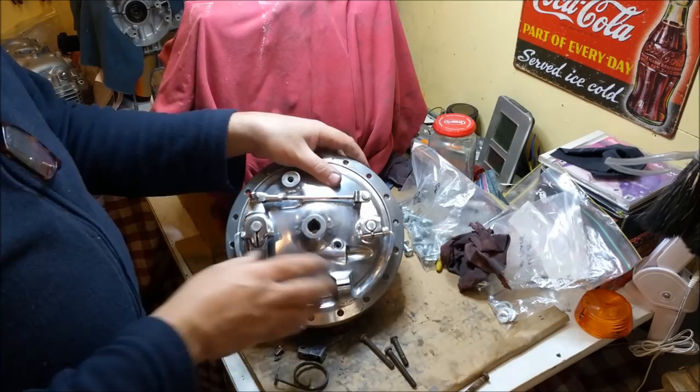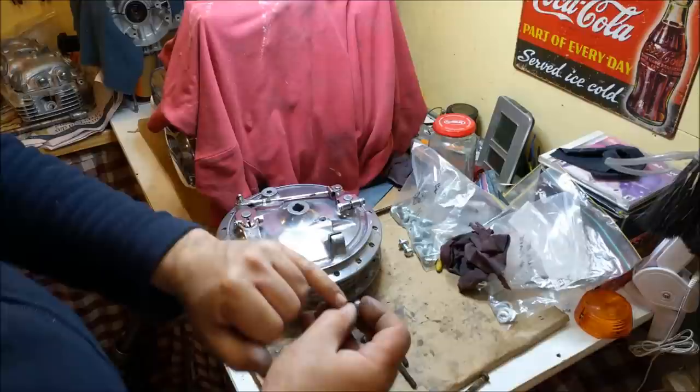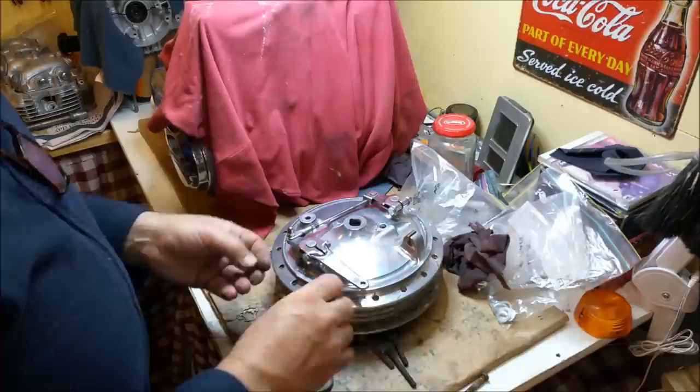This isn't set up properly. It's supposed to be a clevis pin, or at least a pressed pin there. You could probably reuse it by center punching the middle, but that's your brakes, so we don't do that, and it could come off if we do that. There's another one supposed to be here, and that's been sort of ground off to get the pin out to clean it.